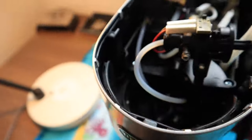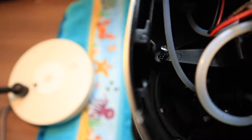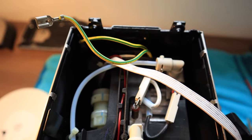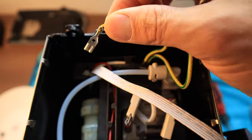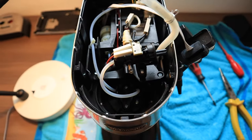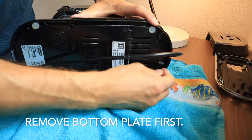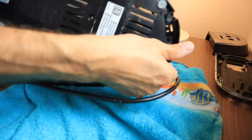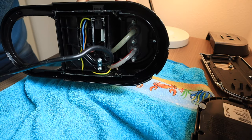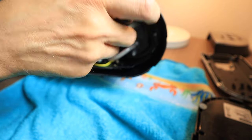We should be able to start to see that when I press up here on the steam wand, the cassette starts to come up. We want to remove the cassette. Before going further, we have to remove one more ground wire here that was on the chassis and then we can lift the cassette out. Before we can remove the cassette, we are going to have to remove the bottom plate here as well as where these hoses are attached. And then we have to remove the cassette — those are three Phillips screws.